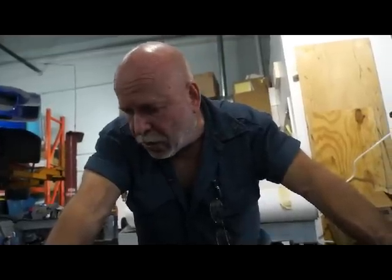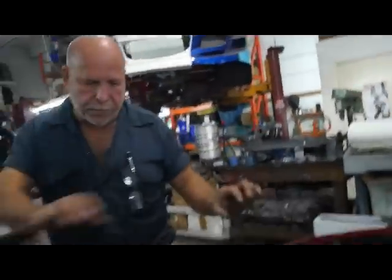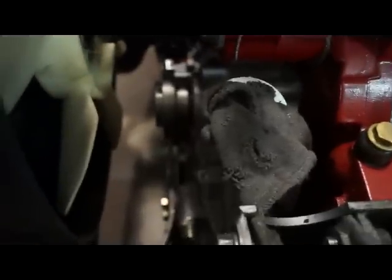The only thing that you actually have to do to make it work is the bridge, what they call the bridge, which is the motor mount on the 12A. Since the 13B is 3/8 of an inch longer, you simply have to drill a hole, not 3/8 of an inch, I'm sorry, 3/4 of an inch, a hole further back for your engine mounts, and that's it. You line up the hole with the top of the slot that you have on both sides, drill the hole there, drop the motor in, and you're done.